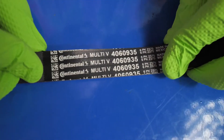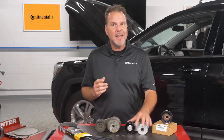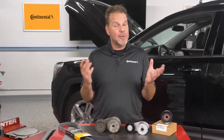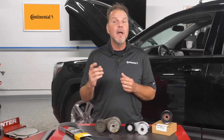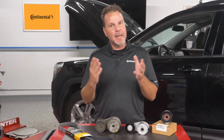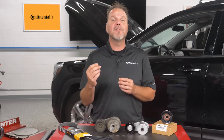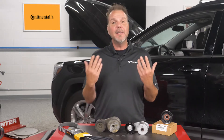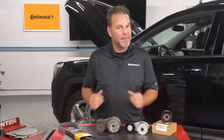The multi-rib belt increases the surface area a belt can use to transmit power to a pulley. The automatic tensioner keeps belt tension constant during changing engine speeds as well as loads. An automatic tensioner has a coil spring that applies the right amount of force against the belt to keep it tight. The tensioner also provides a little give to absorb and cushion shock loads on the belt when the AC compressor clutch cycles on or when the electric power steering activates.